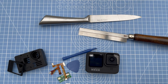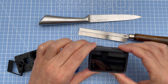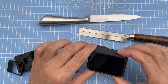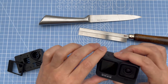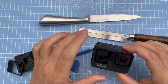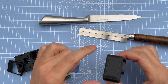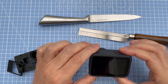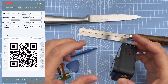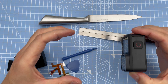One piece of advice before you dismantle this: you need to install GoPro Labs on the camera. Make sure you've got your WiFi settings on and set it to 5 gigahertz instead of 2.4 so you don't get interference. You download GoPro Labs from the GoPro Labs website, put it inside the memory card, put it back in, and it loads up the GoPro Labs firmware. What that enables you to do is download an app for your phone called QR Control, where you can have a library of QR codes with all sorts of settings like pro settings, shutter speed, and then just show it to the front of the camera.